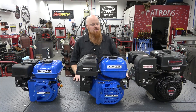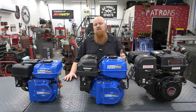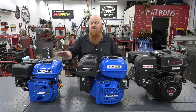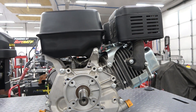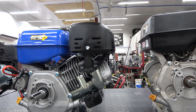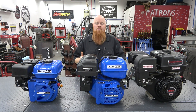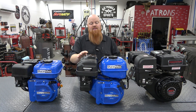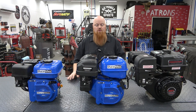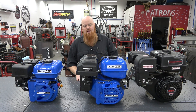It's not a small block and not a big block, but I think it's going to be a sweet engine for a mini bike. I'm going to look into getting a custom cam made for it — the cam journal is close to the same size as a 208 and 212 at 550 thousandths. The challenge with a new engine is getting companies to support it with billet rods and new tooling. I'm going to build a mini bike with this engine soon, and I'll come up with a shimming solution for the crankshaft slop in the meantime.